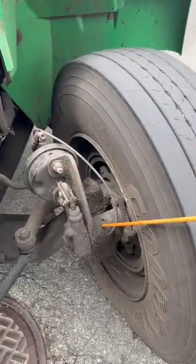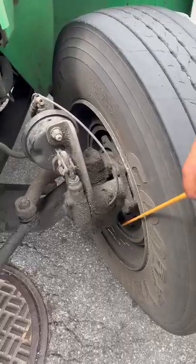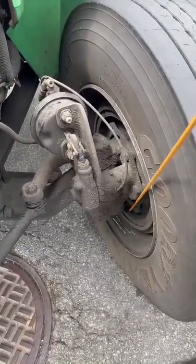Then I'm done with my brake system, now I'm doing my tire and rim. My rim has not been broken or cracked, no illegal welds. My brake cover has not been broken or cracked, it's secure. My brake drum has not been broken or cracked, it's secure.